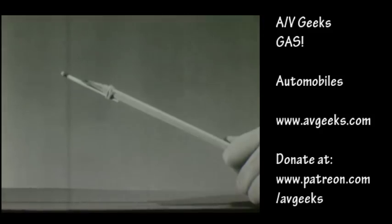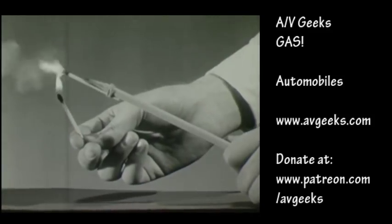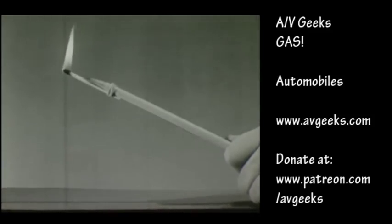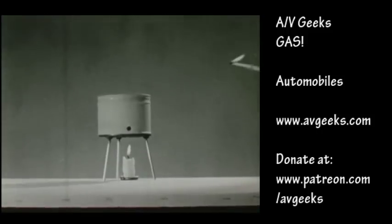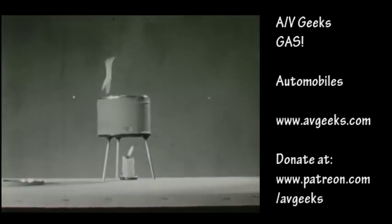And now for the power stroke. Are you ready? Here we go. We attach a match to a long pencil with a rubber band. Light the match. And holding the far end of the pencil, put the match in the hole. The match acts as a spark plug and explodes the mixture of gasoline and air.